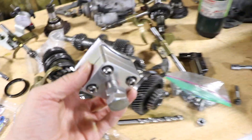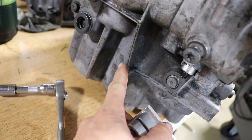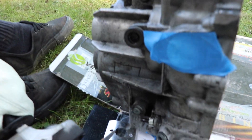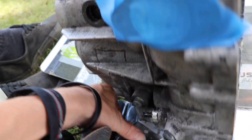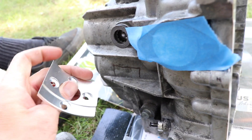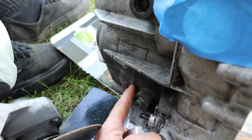For the fourth gear support, we're going to have to grind it down and make sure it's going to be in the right spot — it goes right here. We got the grinder out and we're going to cut this little ridge off in order to fit it in there. We're using a little template: both of these holes are in line with this piece, the up-and-down holes are in line with that piece, and we're just following it and making it happen.